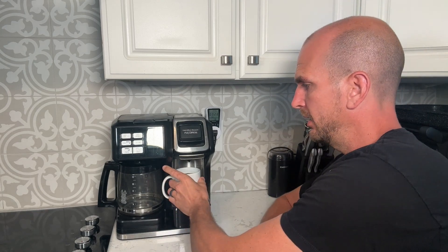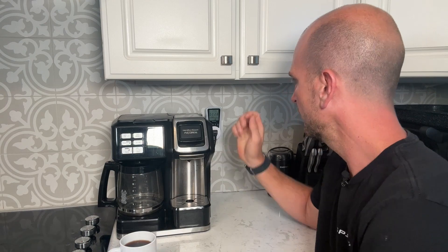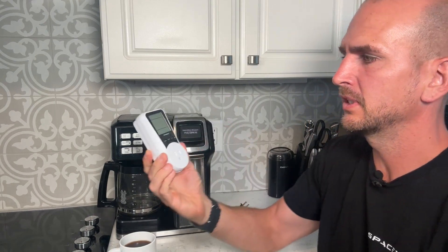That test was easy enough to run — we have a nice cup of coffee. At the end of that cycle it read 0.028, so almost 0.03 kilowatt hours consumed to brew one cup of coffee. So if you're doing some type of setup — a tailgating setup, powering with solar, or a tool trailer with a coffee maker — you can say energy consumption is about 0.03 kilowatt hours per cup. Multiply by how many cups over a duration of time, and that's what you'd budget from the coffee maker, then add that to all your other appliances or energy needs.